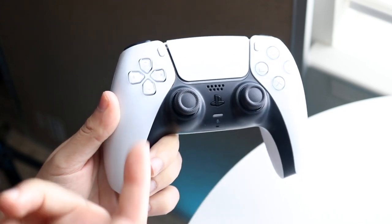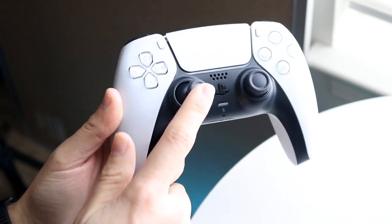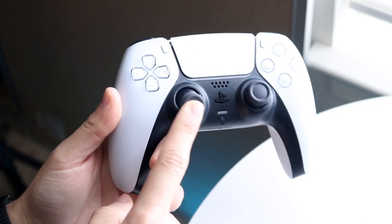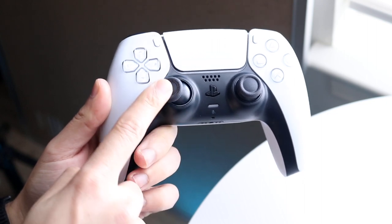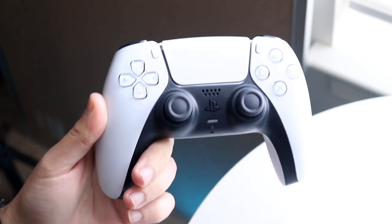Let's say it's the left joystick. What you want to do is bring your joystick around and inspect it a little bit to see if there's anything unusual going on. If it's actual joystick drift, it may be an internal component that you can't even see, but if it isn't, you may actually be able to see some residue or a sticky situation going on on the side.